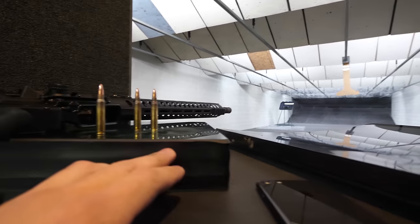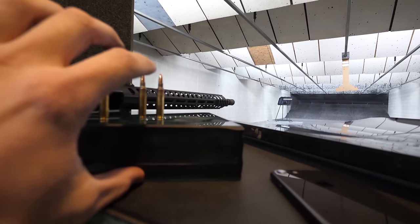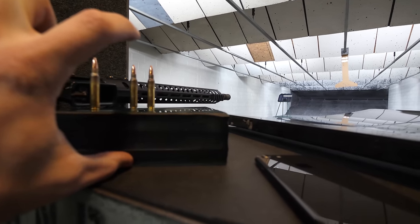Really all of this stuff is completely customizable. The President's Motorcade uses about double this thickness of glass. It really just depends on how much protection you want and how much you're willing to spend. Bulletproofing a car for a handgun usually adds anywhere from 400 to 500 pounds. But if you're going to fully rifle-proof your car, you can add anywhere from 500 up to maybe 1,200 or 1,300 pounds. Your gas mileage might go down slightly, but sometimes that's a good trade-off.